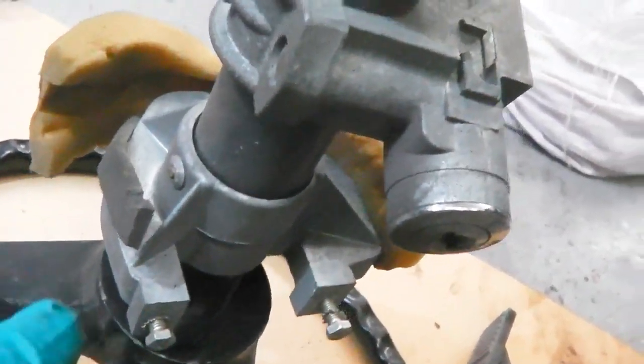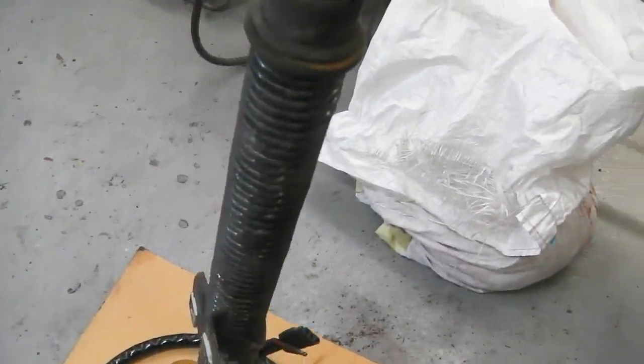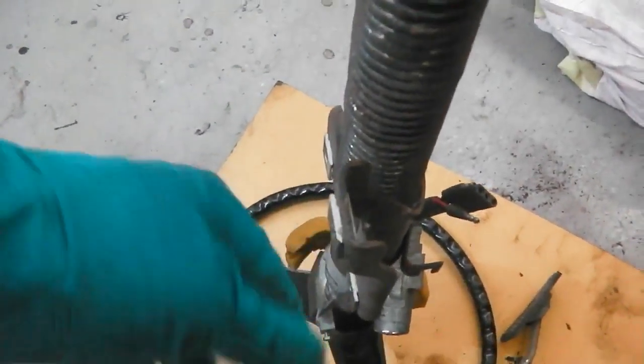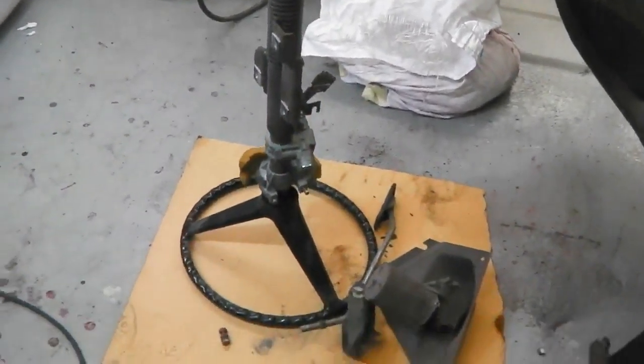We'll be able to get the shaft out. The collapsible shaft will come out. That doesn't get coated, that's left as it is. It's just the casing that we want, the telescopic casing. You'll see that it's ribbed so that it can collapse on itself. And inside, the shaft, as opposed to being one solid steering column, slides in telescopically. So the idea is the impact comes from this area. You're coming from that area, so this can slide and separate away. And then the column collapses on itself.